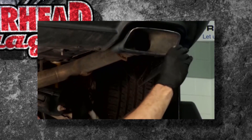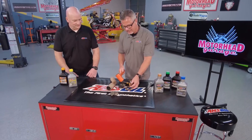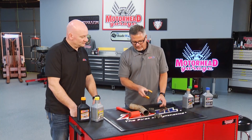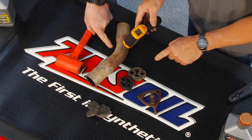You can take a rubber mallet and tap it and listen for any rattles. This rubber mallet is phenomenal for hitting these parts — you may hear something rattling. Or you can shoot it with an infrared gun and check for temperature differences. For example, if it's 600 degrees here and 200 degrees here, we know we've got a restriction.